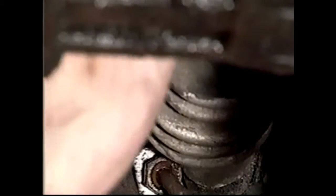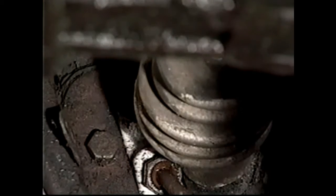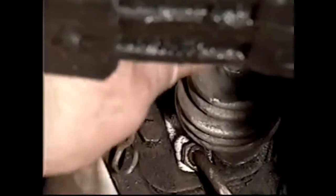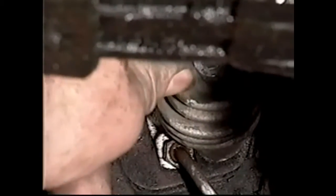So, and we can put the rubber boot on. Put our rod through. Put that over the lip. So, take our two S clips. Put that one in there. You've got an S on the rod and an S on the backing plate, and that's the linkage.